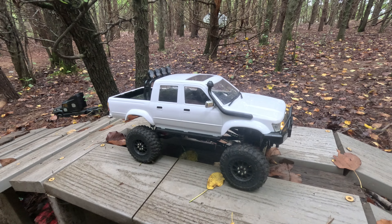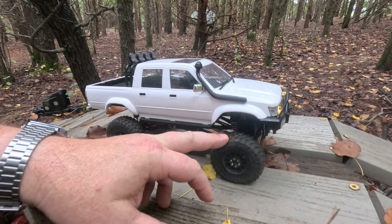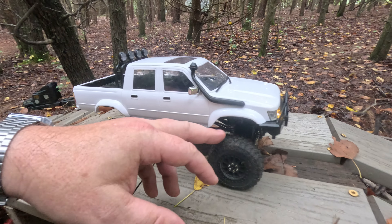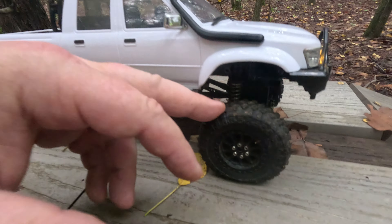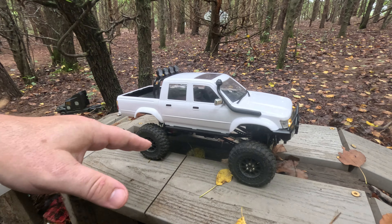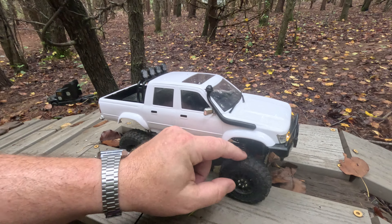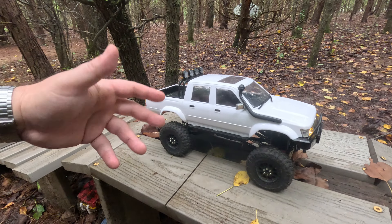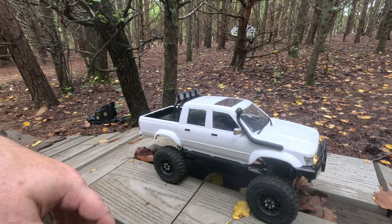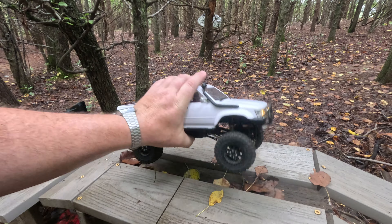What's neat is there's a little controller here. You can turn the drag brake off and on with that switch. And then you also have your steering rate. So if you get this thing stock and you don't like the steering, you can cut it back. With the switch off, it has that much steering. With it on, you can see it — it has just a little bit more. So it gives you more steering with that button.